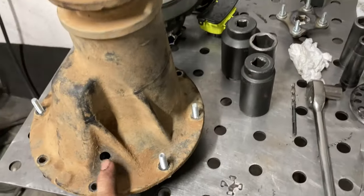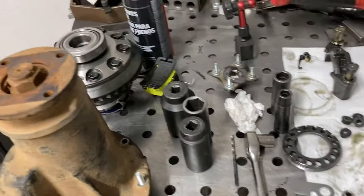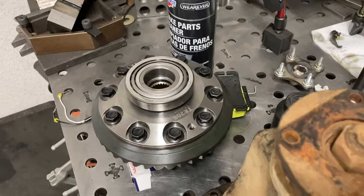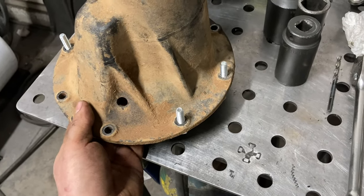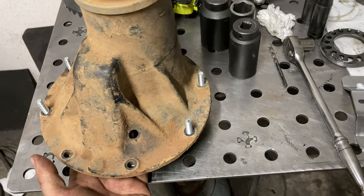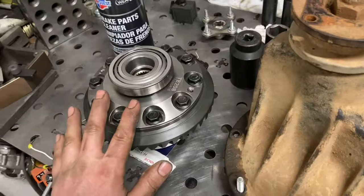Something important — especially since I'm not taking these bearings apart — you want to do all the drilling and tapping from the outside so no chips can get up into the bearings. Cleanliness is number one with all this gear work; one speck of grinding dirt or sand can wipe out your bearings. Triple-check the cleaning before you drop everything together.